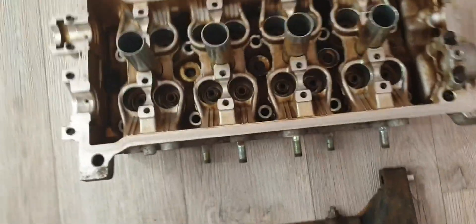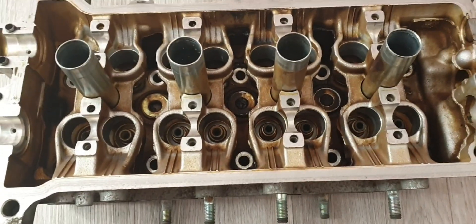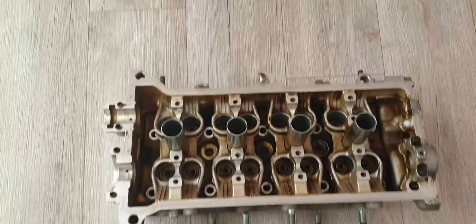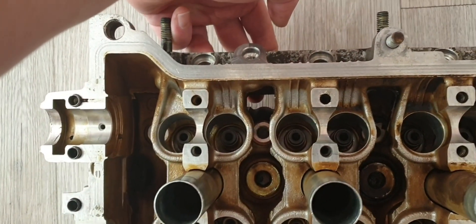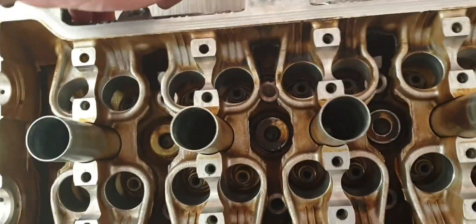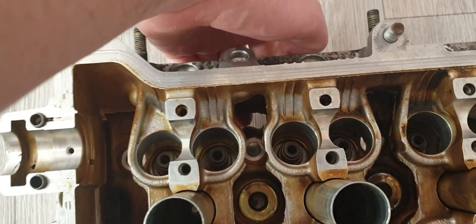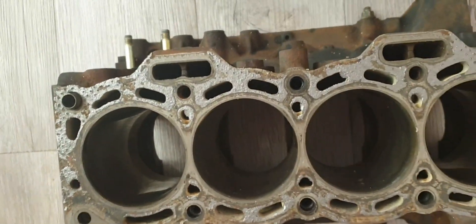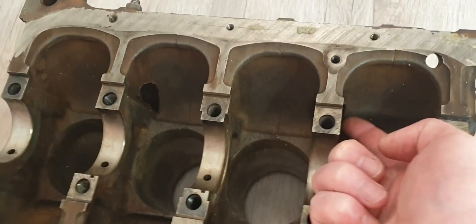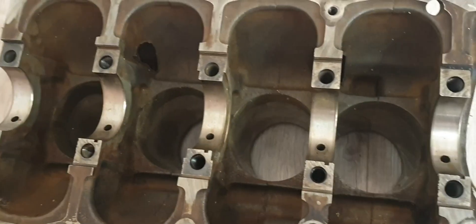Once oil gets into the cylinder head, I think these may be oil galleries but I'm not sure. It will eventually need to get back down — how does that work? Where does the oil go? You can look over here and we've got these holes. So they will eventually come back down, and if we match that to the block you can see that these drainage galleries mate up to the block over here and that comes back down into the block. We turn the block around and we can see that those two galleries blow down there and there, and yeah, eventually back into the sump.